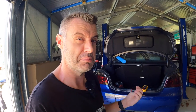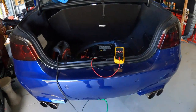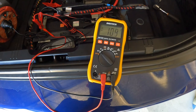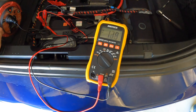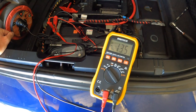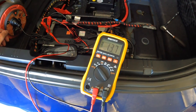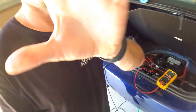When I've been cleaning out the other day it now smells like dead animal — there's just so much crap in there and the car's done 120 Ks. So if you've got an E60 M5, make sure you check your radiators aren't clogged. Last thing to end the video off — let's see what happens when we start up. Dave, can you start the car up? You can see there it's gone down to 11.7 and it should take a few seconds for the alternator to kick in. And there it is — alternator's come up to 13.5, charging away. These do have a smart charging type of alternator and it seems to be operating as it should. That is brilliant. Success.